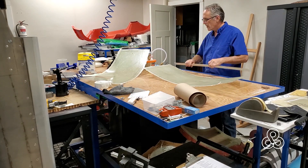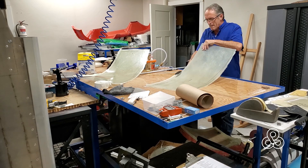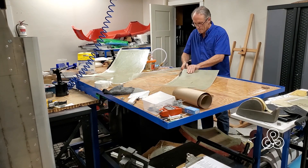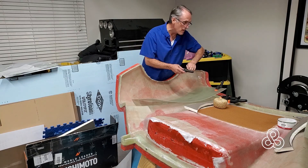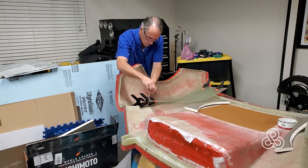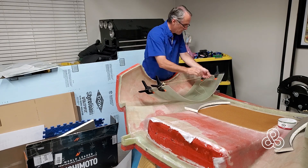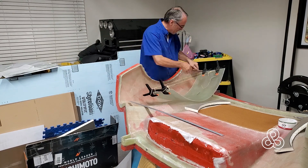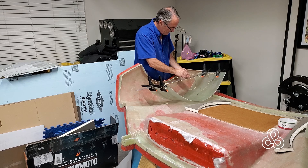These panels came out to be just about an eighth of an inch thick — not so much that I had to get the abrasive cutter out; my big tin snips were able to cut through it. I'll trim three sides and then the arch side and go start fitting this to the clamshell. I formed these panels and then before they were fully cured I put them on a surface so they could bend a little. Put some clamps on the ends with string pulled tight to get the curve I want, threw a ruler on there to make sure both sides match, and propped them up with a pre-cut piece of foam.